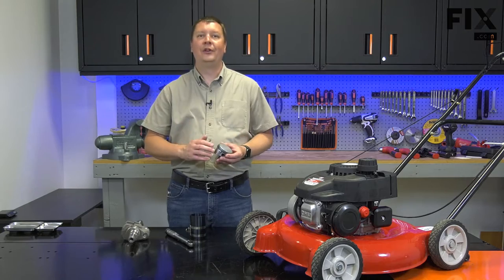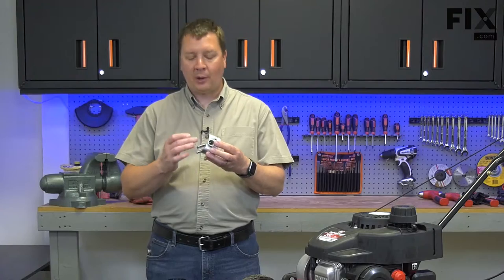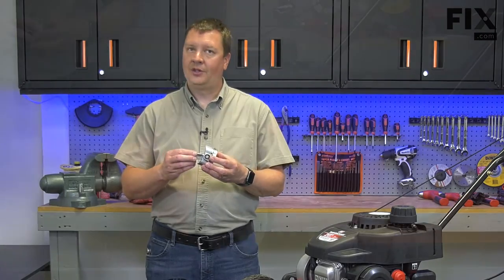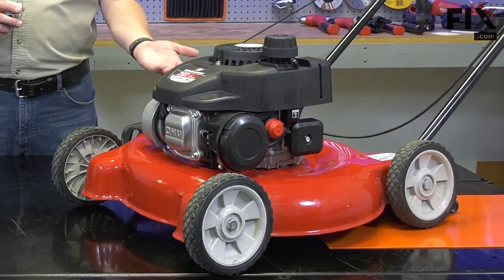piston, and the cylinder. If the piston seizes to the cylinder due to low oil, the connecting rod will have damage to its journals. It may break in two due to the sudden stop. It might also break if the governor is set to allow the engine to run too fast.